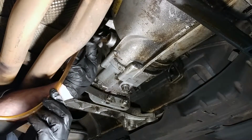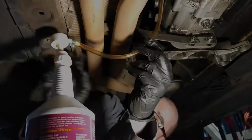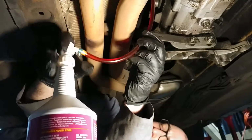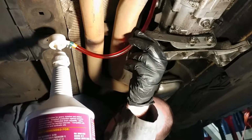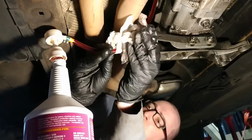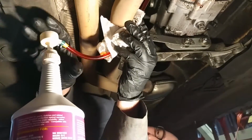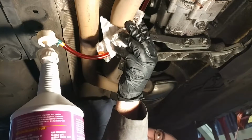Make sure the hose is inside the transmission far enough to keep fluid from dripping back down the outside of the hose. I used a couple pieces of 2x4 under the bottle to raise it up. I also used a paper towel to soak up any drips coming back down the hose. This pump is pretty slow, but I still prefer it. I only have to do this once every 2 years or so. Burn. Arm burn.